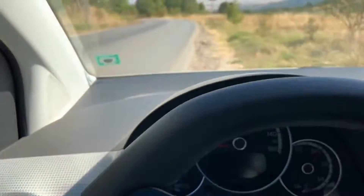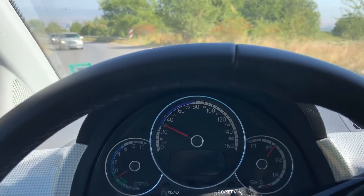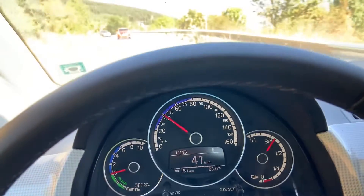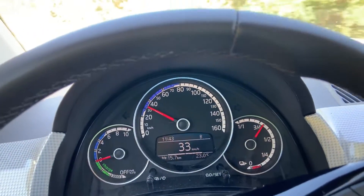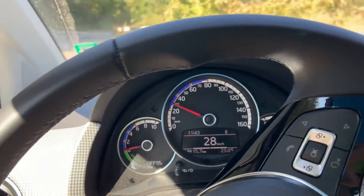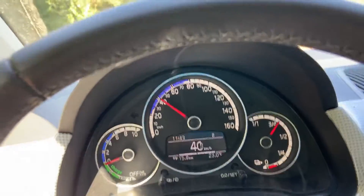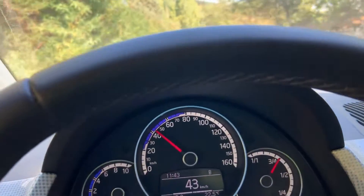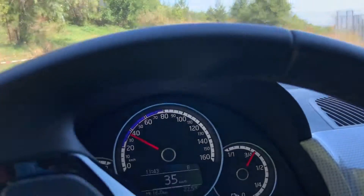So let's try this. You can see that when I release the pedal, the car is slowing down. At around 30 to 40 km/h, I'm releasing the pedal and the car is just stopping. The good thing about the Volkswagen E-Up is that you can drive with whatever level of recuperation you want. You just need to consider the downhill and choose the level you want. The main goal is to not press the gas pedal — so when you have a turn, you just release the pedal and the car stops automatically.